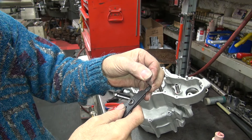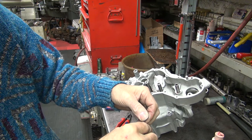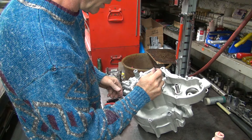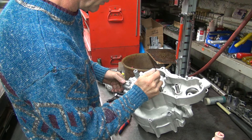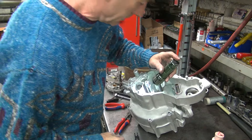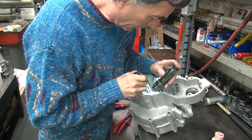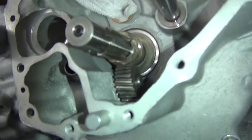So now you can put it on top of your pliers, which is hard to do now because some dumbass bent the damn clip. So you have to kind of bend the clip out by hand and hook it on the titties like that. You need to slip it in there and do not overextend it any more than you have to to get it on there. You have to push on the rest of the way with the screwdriver if need be. Looks like it was already on there all the way. It's nice and snug. So now it's in there nice and tight.